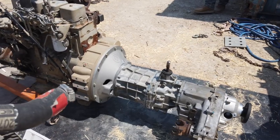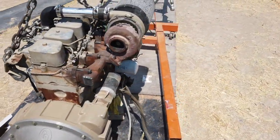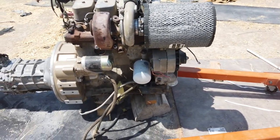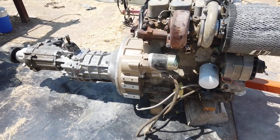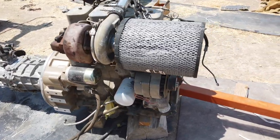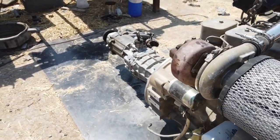I just made this video because I couldn't find any information on whether you could interchange an input shaft from a 92-plus to a later model. But it will fit, and who knows — maybe you've found an old AX15 and need to put it in a newer Jeep, or maybe you've got a newer AX15 and you're putting it in an older Jeep. The information is out there now: you can swap out input shafts on the AX15.